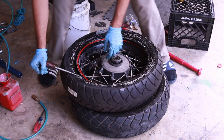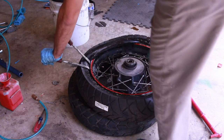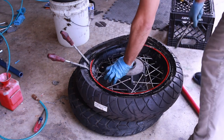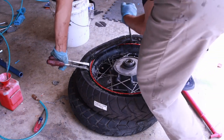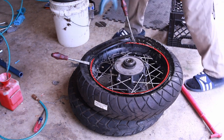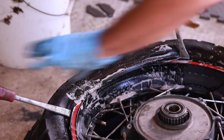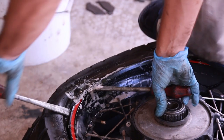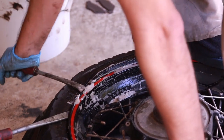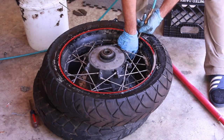Now comes the part that I don't find fascinating at all — mounting the tire on the rim. Just go around with your tire levers and work it slowly. I'm going to push down on this, give it some more slack. This last portion is always the hardest for me, so I like to get plenty of lubrication on here. Always the most difficult — definitely the type of thing you need a helper for. The tire is actually going in. There we go — the tire is in there. There's the valve. One pop — let's put some more air. You should hear two pops.